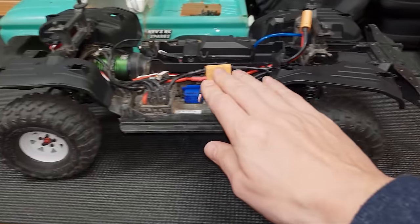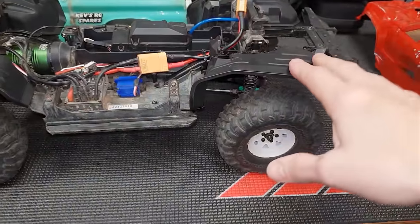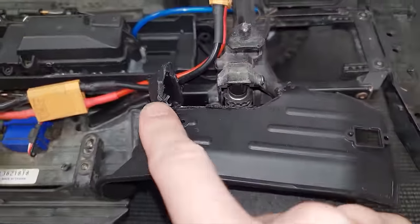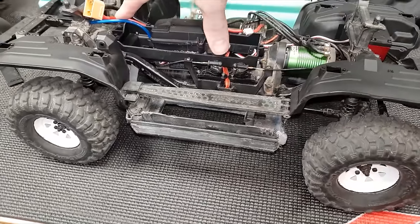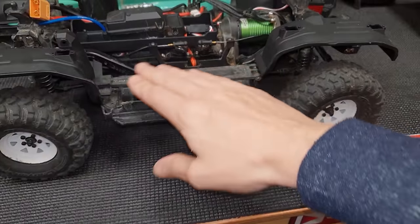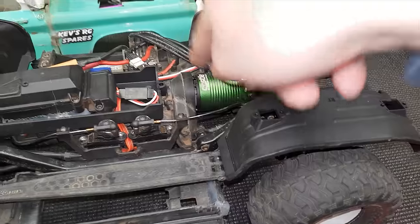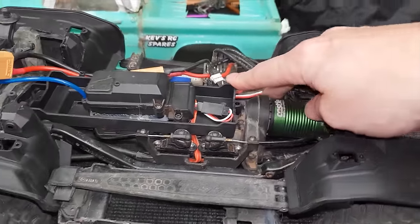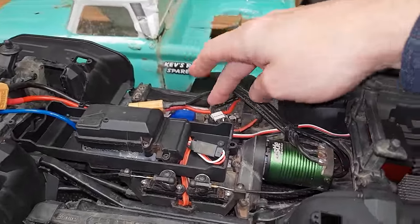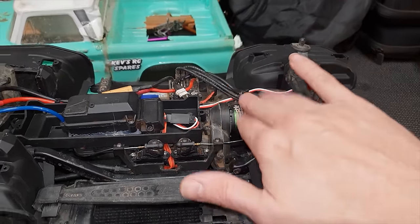I've added these arches and they're a bit of a bodge — I'm going to have to do them again, they were kind of just slapped on, I was in a rush. Anyway, what I did was I moved the battery location from up here to down here, which brings the center of gravity right down. Then I put the receiver up here. Also running in here, we've got a Castle Mamba X system, so this can actually run on 6S LiPo. The ESC is rated for 6S.